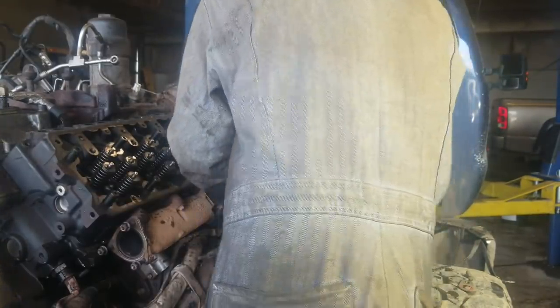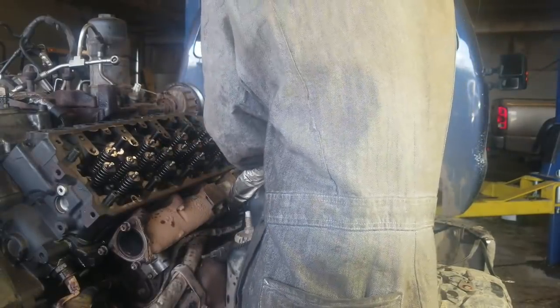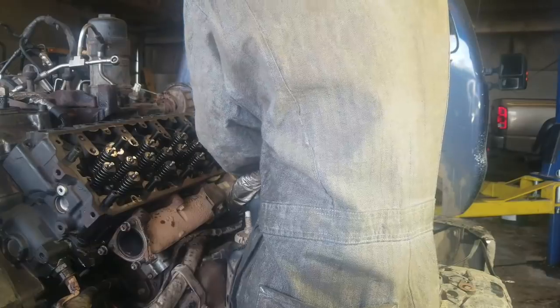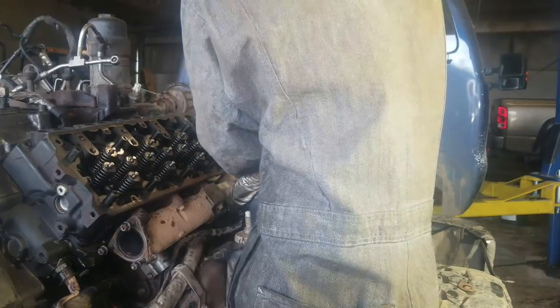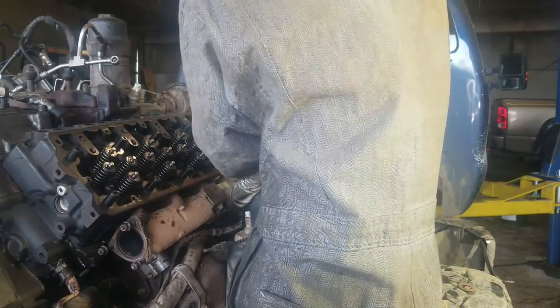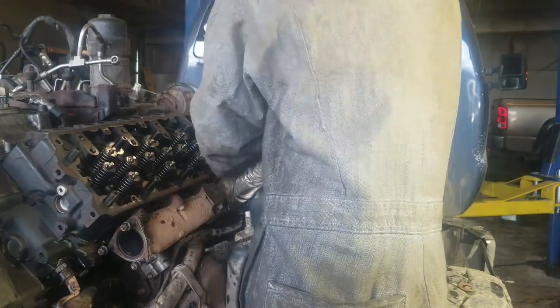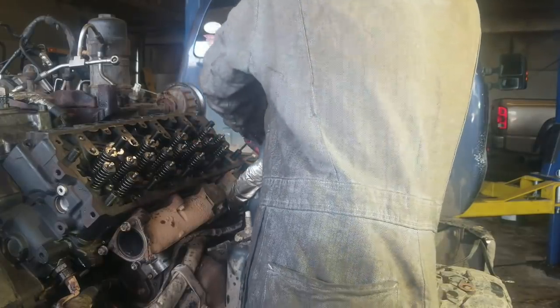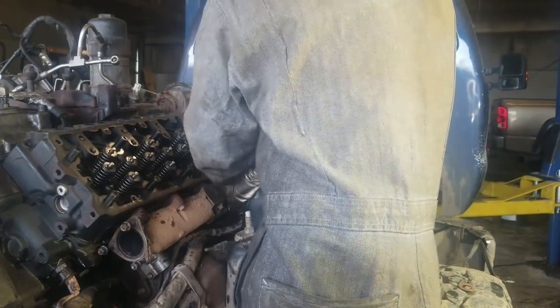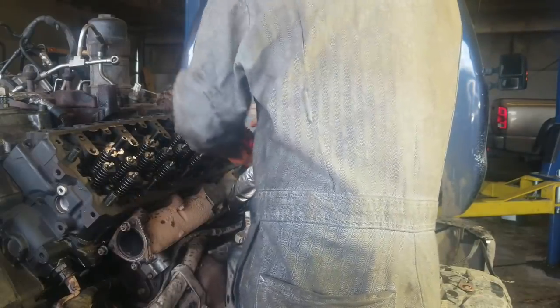So we know exactly why the CP4 fuel pump failed. And now I'm really understanding, because I pulled that filter underneath the cab out and I noticed there was a bunch of muddy looking dirty stuff in it. And I thought, man, his fuel system's dirtier than hell. Is he dumping dirt in the fuel tank? I really didn't pay much attention, didn't look behind me at the fuel tank, and didn't notice all the slimy stuff all over it at first.